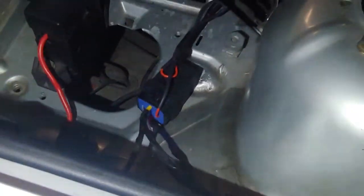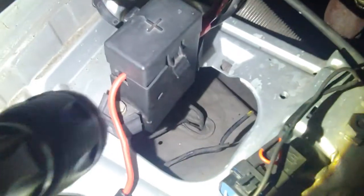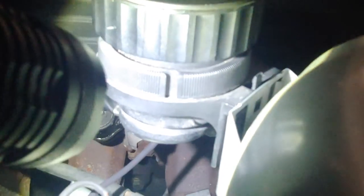The relay connects to the fan down there through a red wire, which is run through all these grommets here. The relay also needs auxiliary power — the battery connection is there, that's easy. The auxiliary power connection is going to be under this piece right here, and there's a grommet underneath — you stick a screwdriver and remove that.